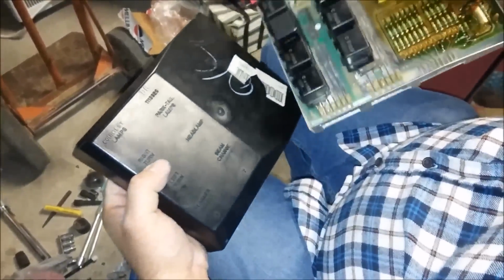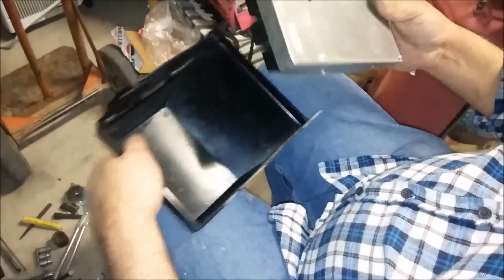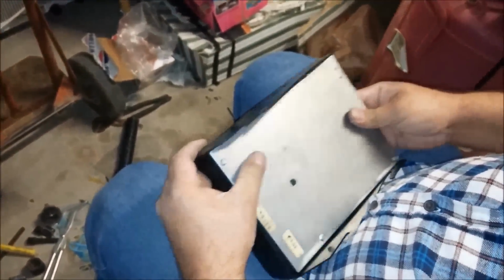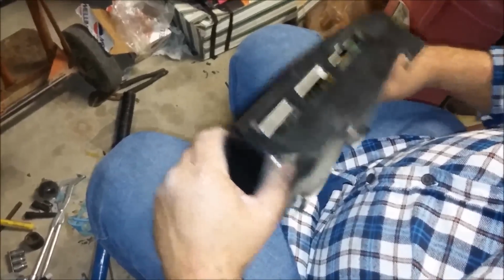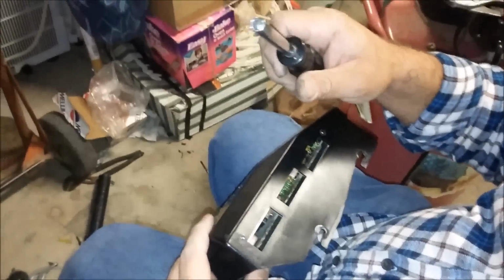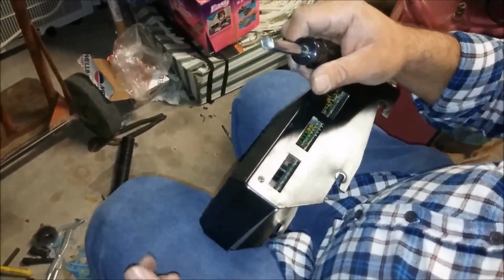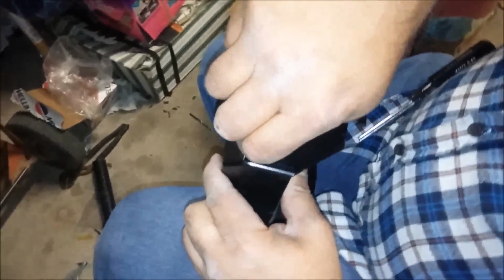Okay, we're going to go ahead and reassemble our flashing, all of our relays here that we had near our brain. Flip everything upside down. Make sure your connections are correct to the locations that they're supposed to go to. And then you slide this back in. Try to align them as close as possible. And then you get your driver. In this case, I'm using a regular type driver. I don't have my little extensions in there, but this works. Whatever works.